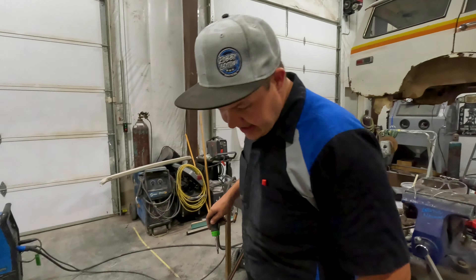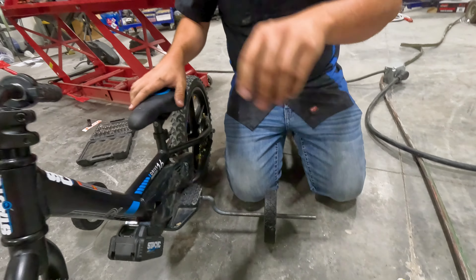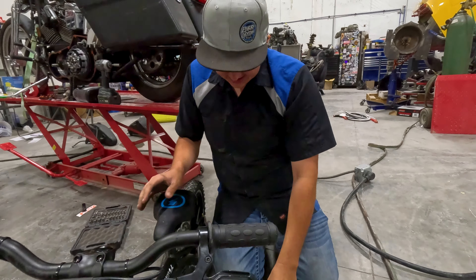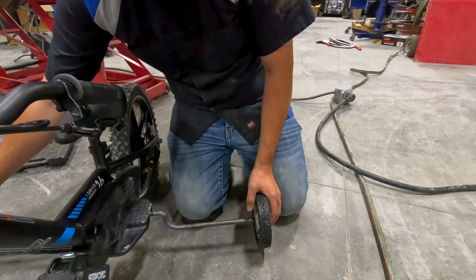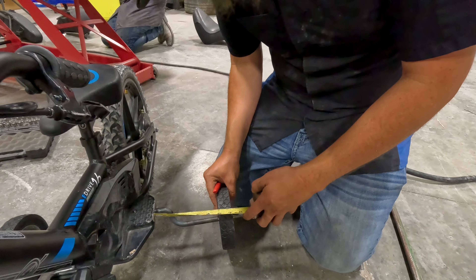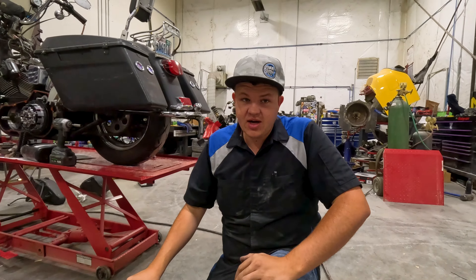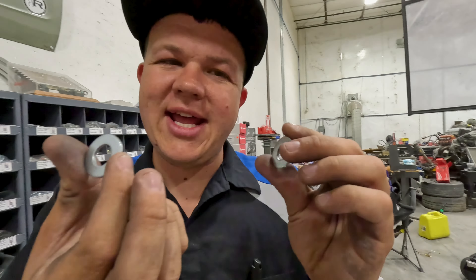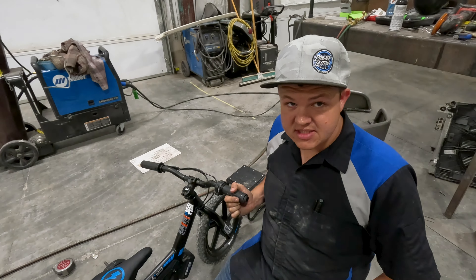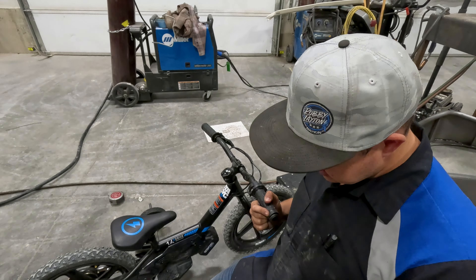There's one tank. I want to get this tightened up and then we're going to flip it over and check the wheels. I wanted about an inch of movement — look at that, it's going to work perfect. She can ride it, bounce off one wheel, go the other wheel — it's exactly what I wanted. I'm going to measure this out — I think I'm going to go six inches. I'm going to pin the outside, but I need the inside to hold the wheels. This is a half-inch rod — we're going to go grab some half-inch washers. Look at that — just what I needed. Perfect. We'll take this back off and weld those in. She's going to love it and she'll be here at five — we've got to hurry because it's like four o'clock.